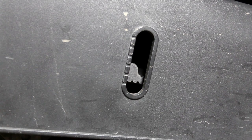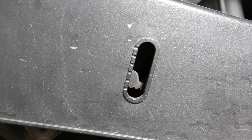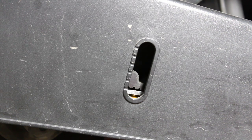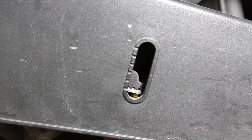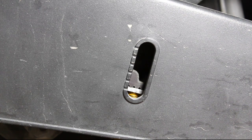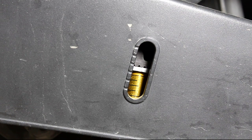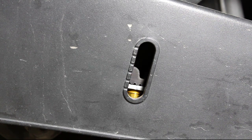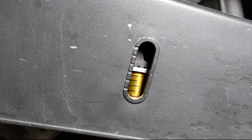Let's go ahead and rotate it to the twelve o'clock position on that valve stem and try it again. For the twelve o'clock position, we'll put that gauge in and we see that we're running just right above that first line. We'll give it that ten pounds of pressure and we'll see that we're actually running right at about thirteen millimeters of play.